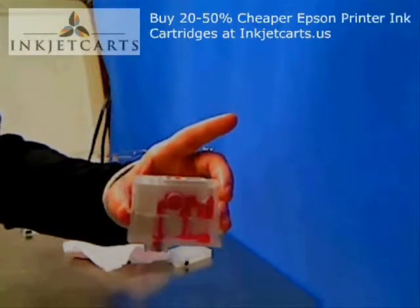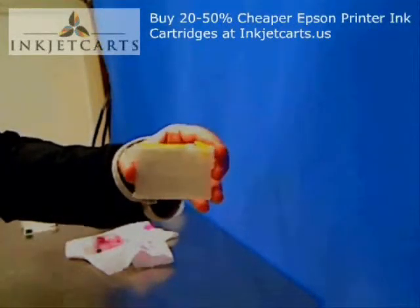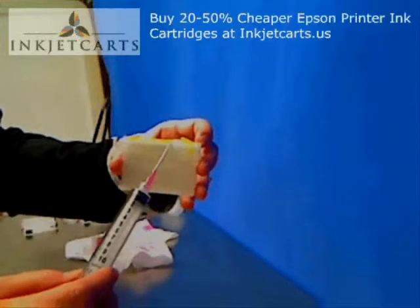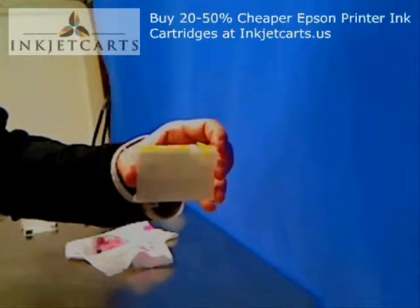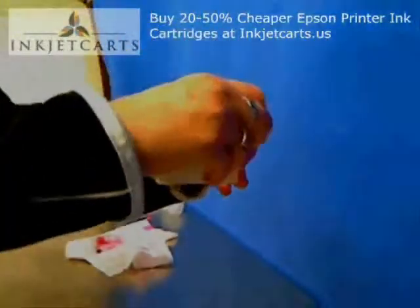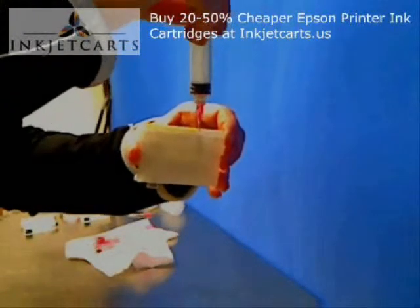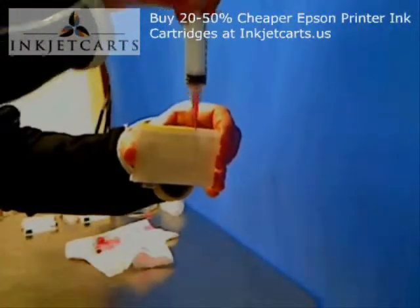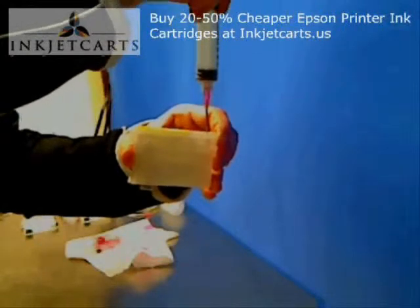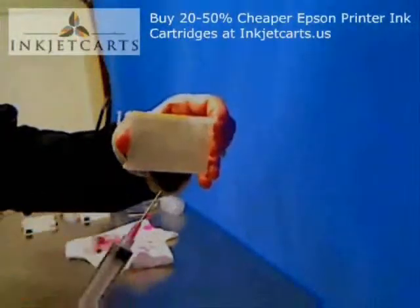Now, this is the same cartridge — same basic design. The only difference is the location of the fill port and the air port. On this cartridge they're very close together, but the same conditions apply. Remove those plugs and insert a needle into both of them to show the main reservoir. Same condition applies — you're delivering inks to the main reservoir and air supply. Same condition: very short baffling, you cannot insert a needle, and it would take you a long time to fill through this port. The main body plug is always where you want to fill these cartridges.